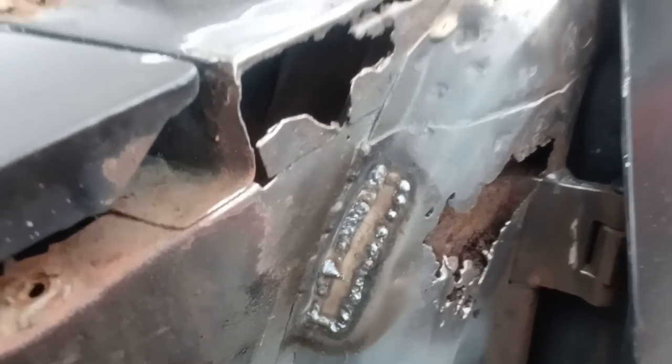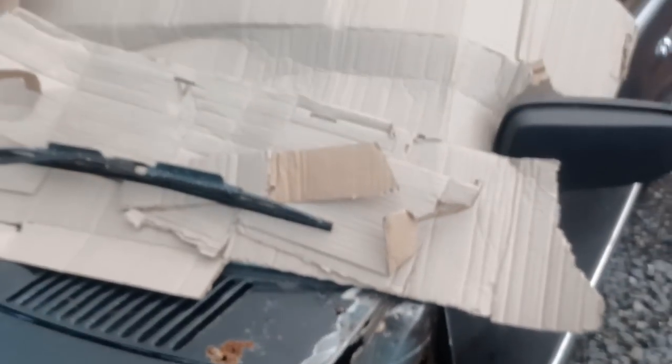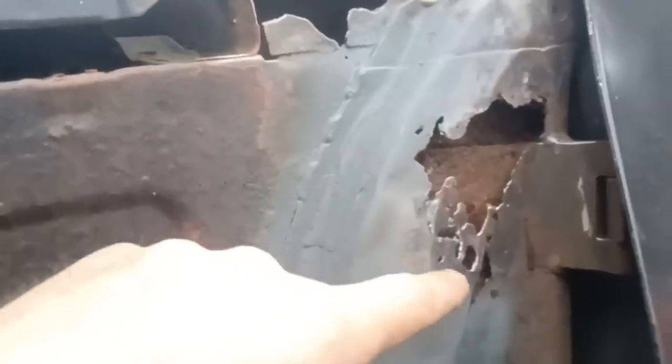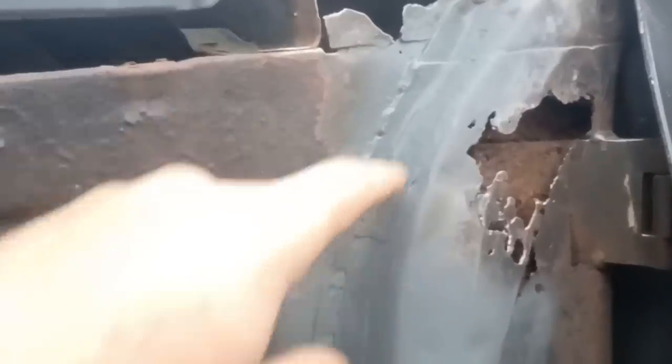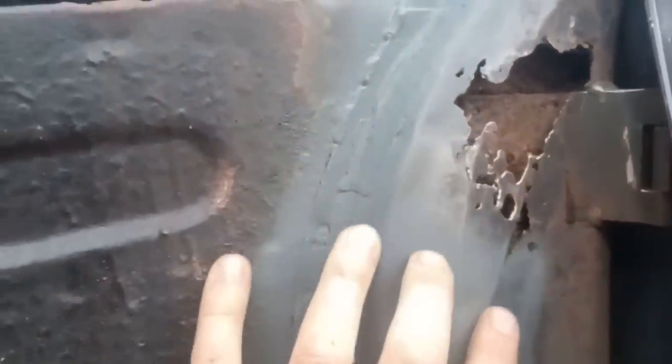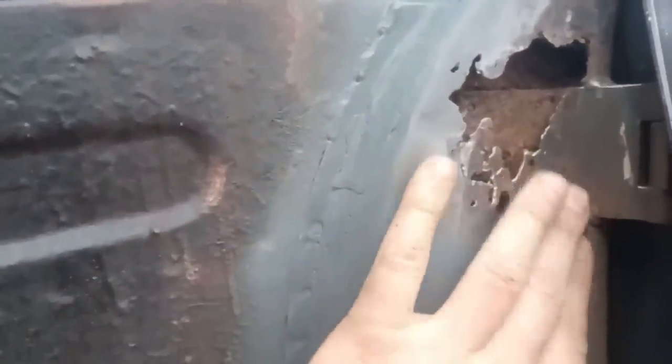Next little bit done. I've added a bit of cardboard to the edge here to try and mitigate against sparks hitting the glass. In an effort to try and keep our shapes here, what we try and do is work on this one strip at a time. We've got an edge there that should carry on up around through there, so I'll work out a plate to go in there and replace that piece, then work our way in. There's another plate in there which goes into that shape, and then we're working our way in. It's not essentially important that it's perfect, but it'd be nice to be somewhere close.